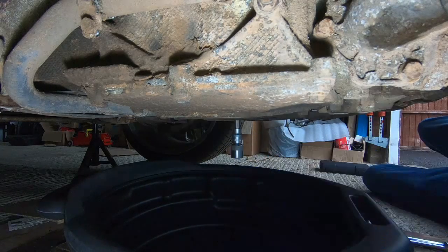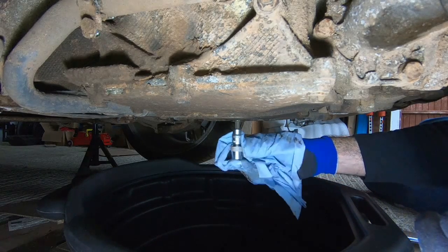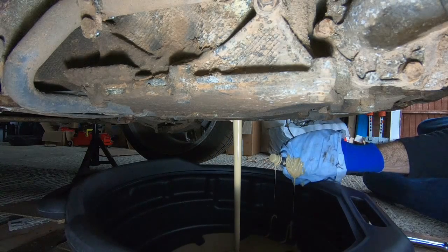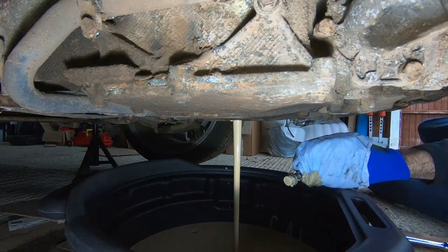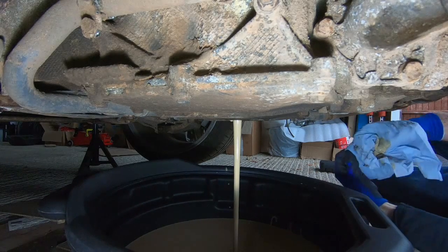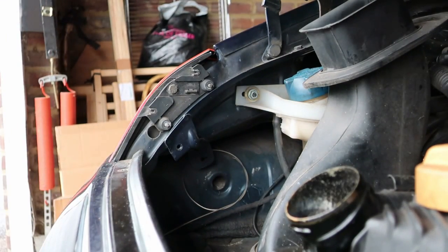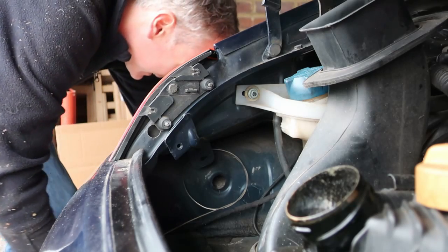The engine's up to temperature. We're going to loosen the bolt and let the oil drain out through the drain plug. This isn't ideal — the milky oil is usually a sign that there's some sort of intermixing going on between the coolant and the oil. That's going to require some investigation. We're going to fill up the engine with some new oil, but whatever we put in here for now is going to just end up in the same state. So we'll get it filled up and then I'll need to do some investigation to figure out what's causing the intermix between the coolant and the oil.